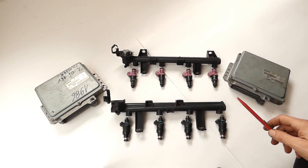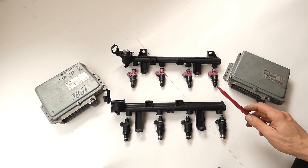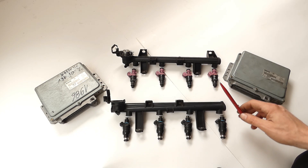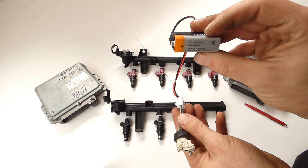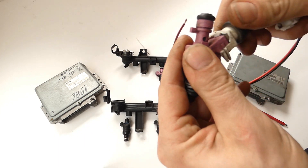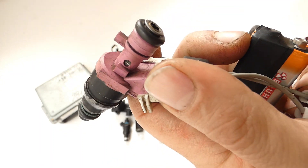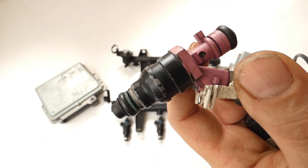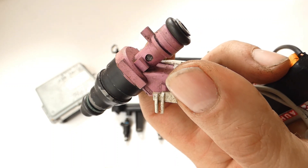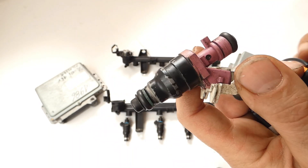For testing injectors there are many videos on YouTube on how to do it, and that's where I learned it too. Simply take an old connector, a 9V battery, clamp them together, and then you can already hear it clicking. These ones are functioning now. The clogged ones didn't do that - and that was of course catastrophic. But you have to figure that out first.